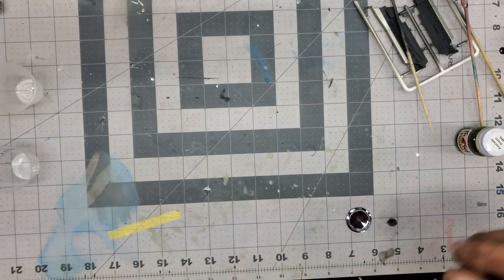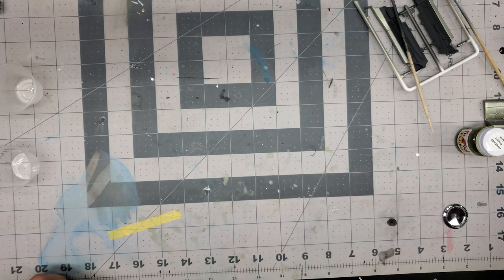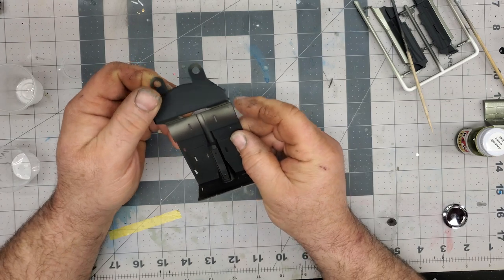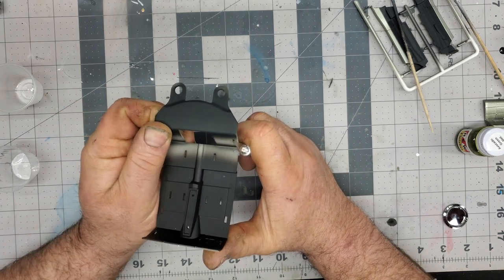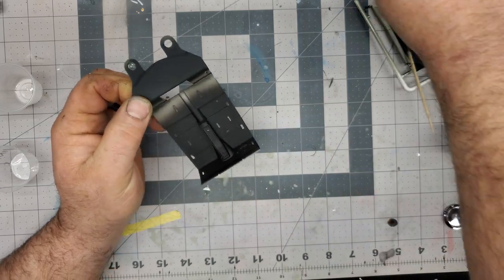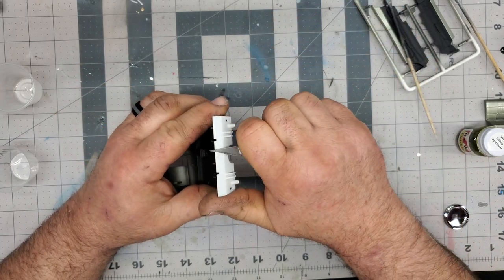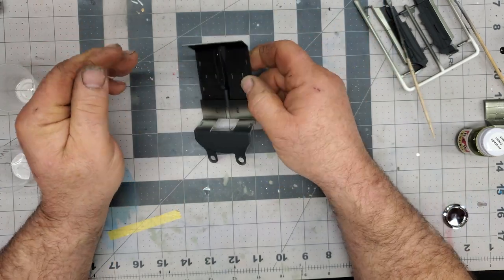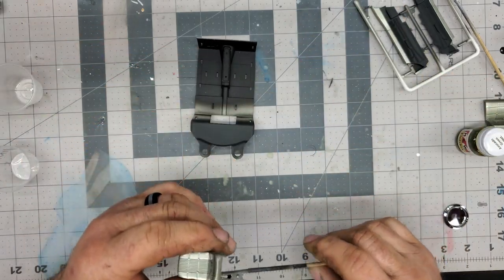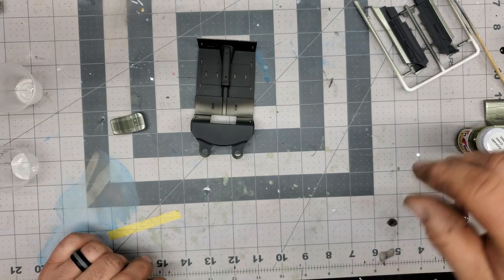As you've seen, I was airbrushing that. I didn't have much body line in the back because I had to sand it so much, so that may need a little more paint back there. The rest of the car looks really good for what I can see. While that's in the Suzy Bake oven - when I put things in my dehydrator to cure, I don't start it right away. I leave it sitting there about a half hour to let the thinner calm down and let the paint level. If I turn the dehydrator on immediately, it'll start baking the paint right where it lays instead of letting the thinner do its job.